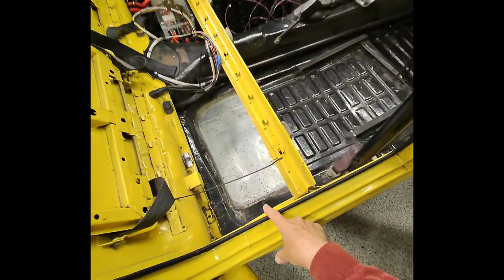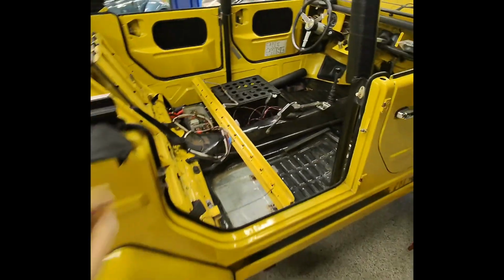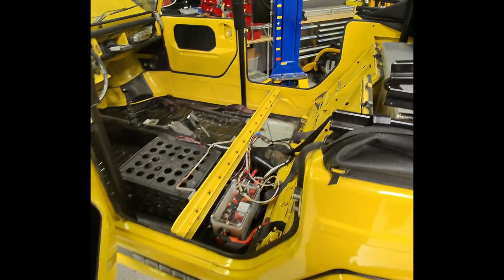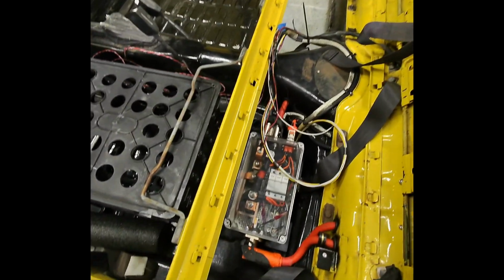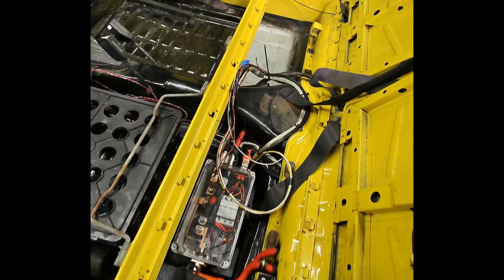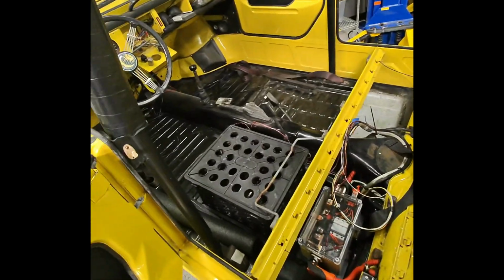We just had to weld in a new battery tray because a lot of cars need that. Your 12 volt battery had acid that would boil over and drip out and ruin your car. This is our new contactor box for the car. Those are all the connections for the relays and fuses for the high voltage system.